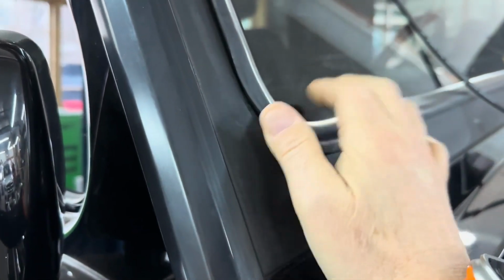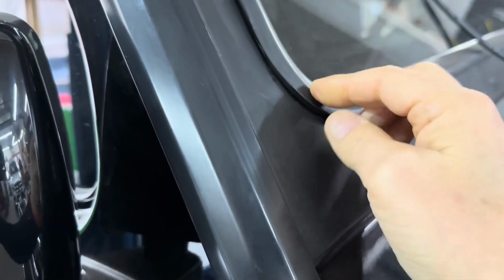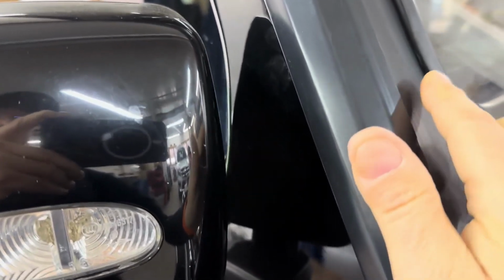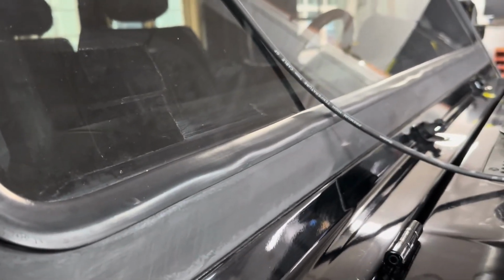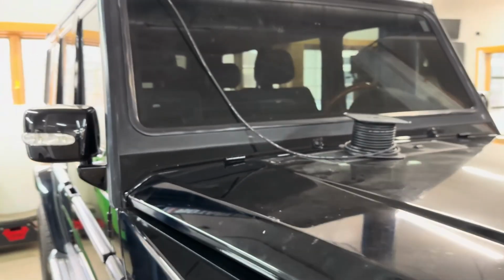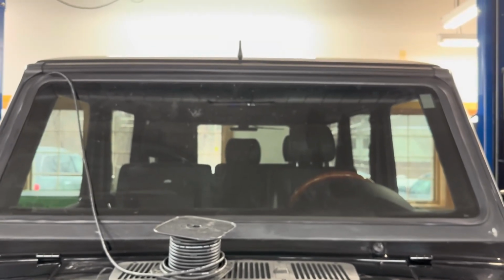And for the windshield, to avoid potential cracking, we pulled up the seal by inserting this spacer cable that you can see in there, and that holds it up, so we were able to get in there. Luckily, the rust was not all the way in. Most of it was on the perimeter. There are a couple of spots where it was a little deeper. We went in there as much as we could, and it all looks very good. So this is flat black primer, and when it goes to the body shop for that quarter panel, they will refinish the windshield frame.